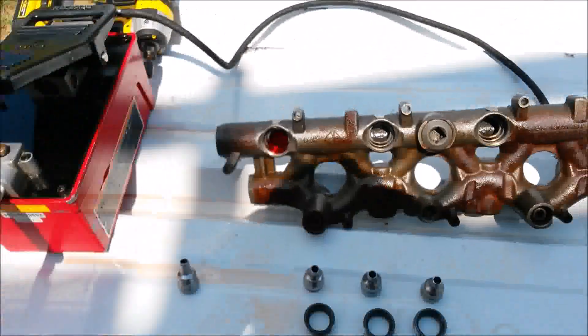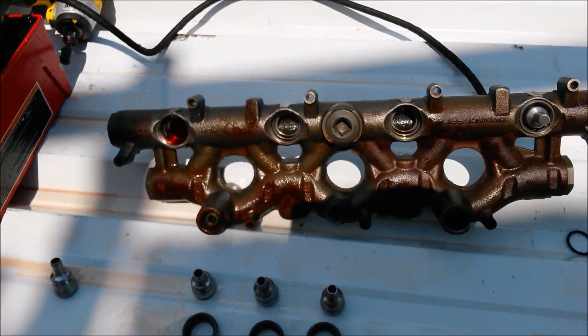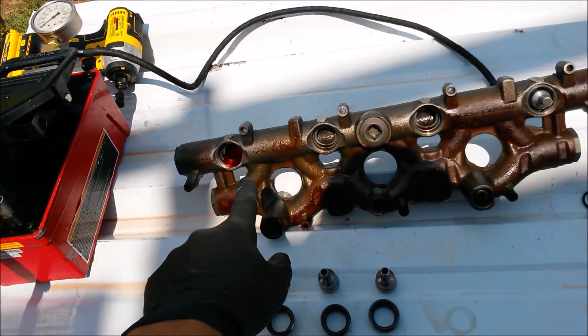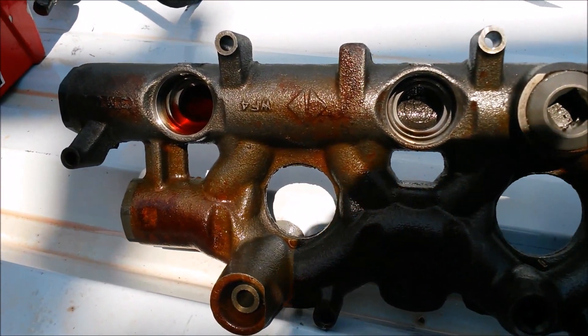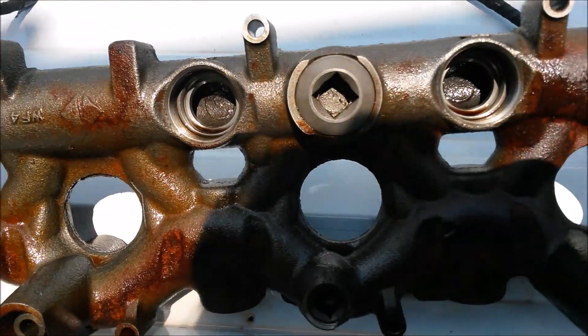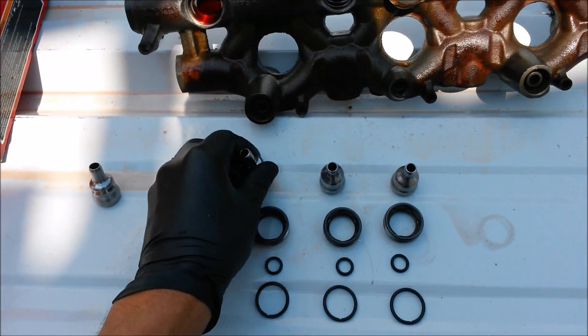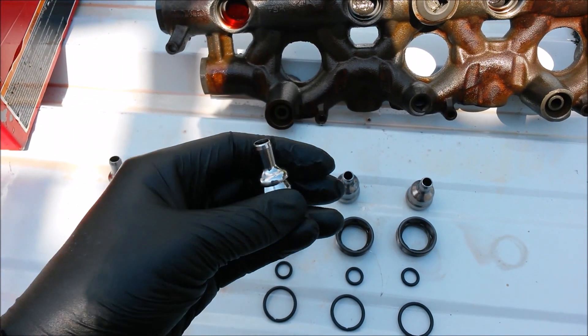What we've got set up here is an oil rail off a late model 6-liter diesel and a 10,000 PSI hydraulic pump. We're actually powering it with transmission fluid so you can see the nice red color — transmission fluid is actually much less viscous so it should leak out a lot better. We're going to go ahead and put in one of our nipple cups. We've got them all plugged up on the bottom so they can't leak out the top.